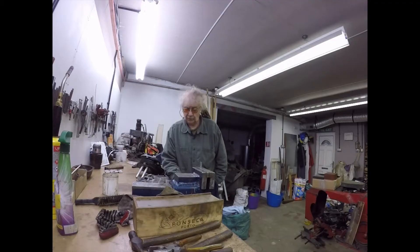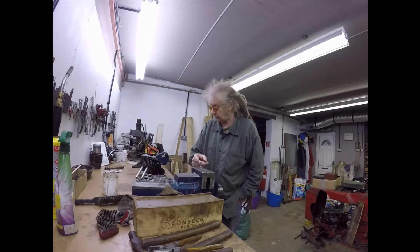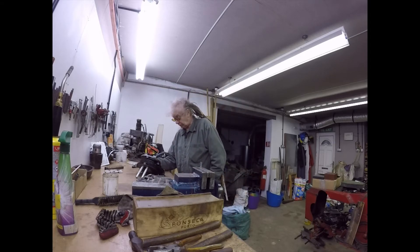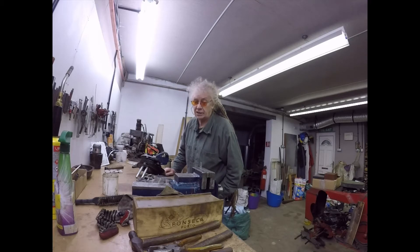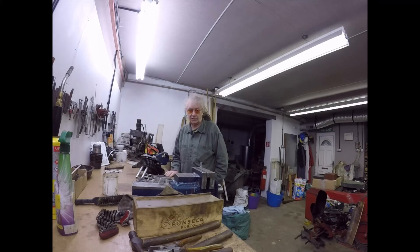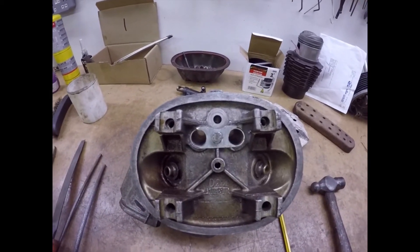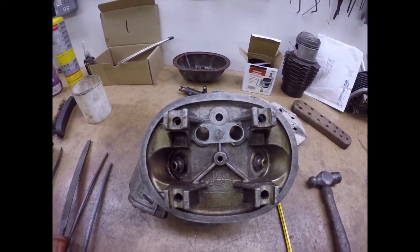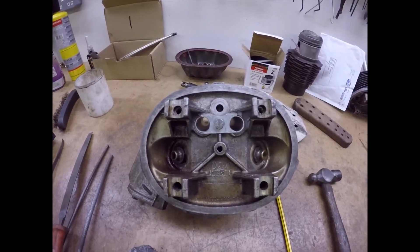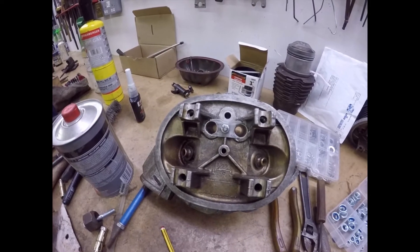Good morning people, Friday. We're on with making a little clip cover to hold the push rod tubes in - it's half past ten. Then anneal the push rod tubes, wash everything off and put it all together. The piston ring compressor has come, so we're on for a reassemble. And there's number two fitted, ready for the stud and a tab washer. We'll make two tab washers next - studs, nuts and tab washers should keep that in position.